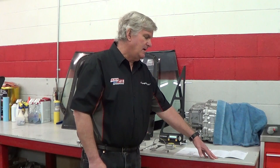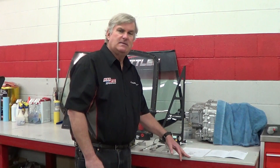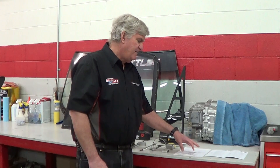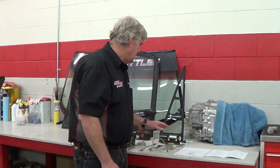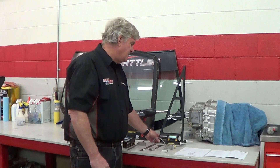Alignment is a big part of car setup. Here are the tools we use when aligning a Supersport. First, we have the manual supplied with the smart camber gauge, which reminds us of the formulas used when calculating caster. We have our setup sheet with all the alignment settings — this is the basic sheet we start with. It has general numbers on it; when we're done, we'll put the specific numbers on it and have that available for the next alignment.